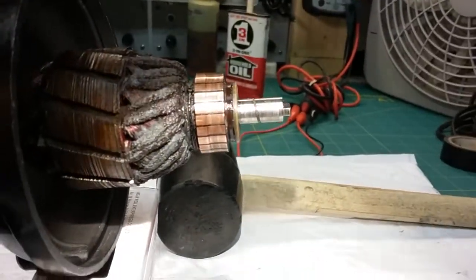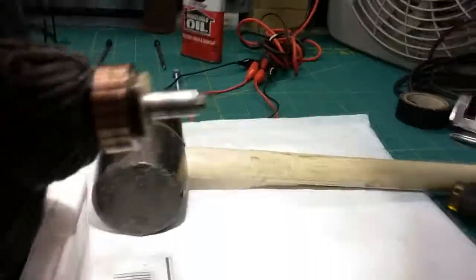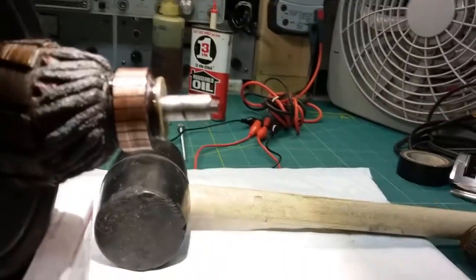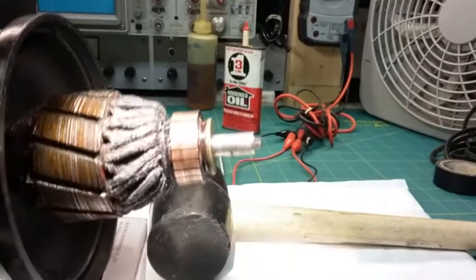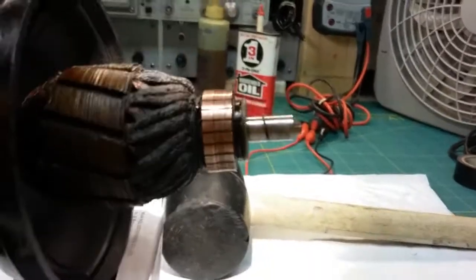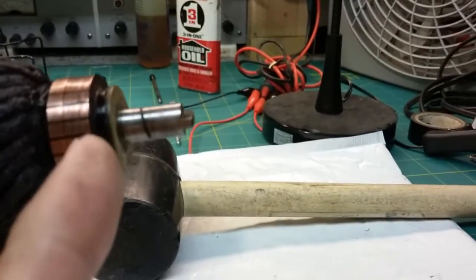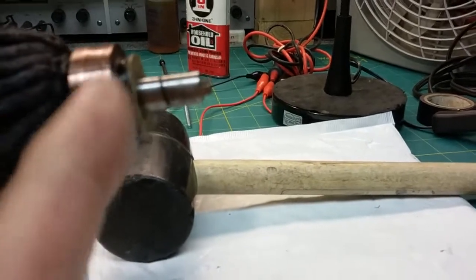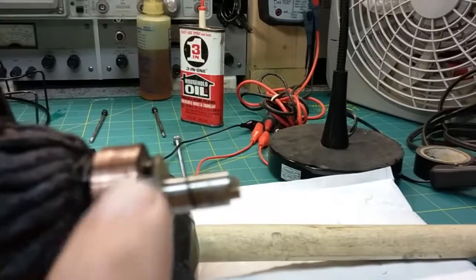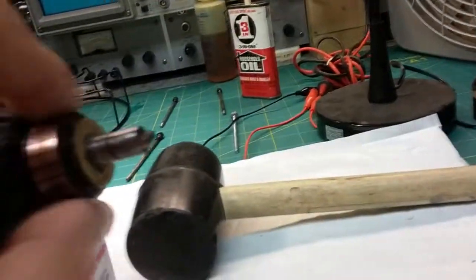All right, let me see if I move my light over here. As you can see, I got a lot of the oxidation off, so it's a lot cleaner. It actually looks better than on the camera. The camera makes so much glare you can't see it, but it's very clean. You can see it there maybe. The brushes only hit on this back half here from that line over. They don't hit here. This is original, so you can see there is a little bit of wear, but that doesn't matter. That's fine, and they're clean. It's clean now, so the brushes should make very good contact.